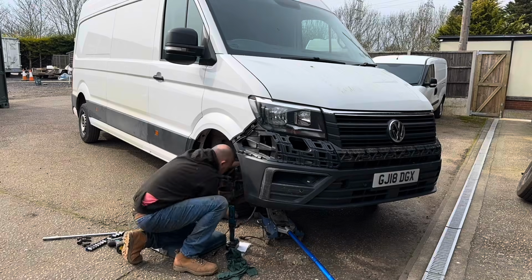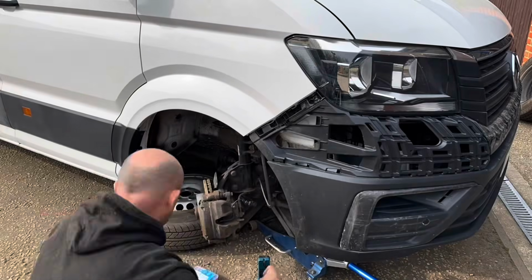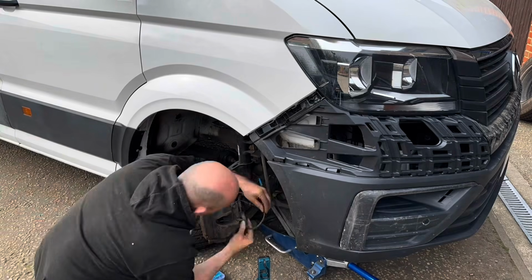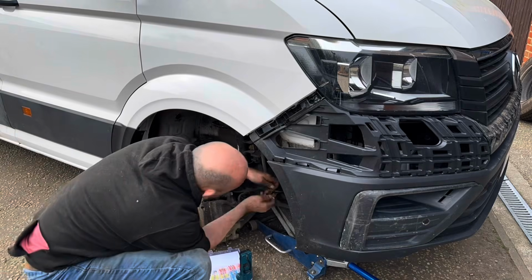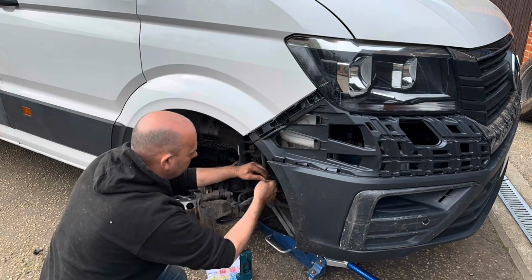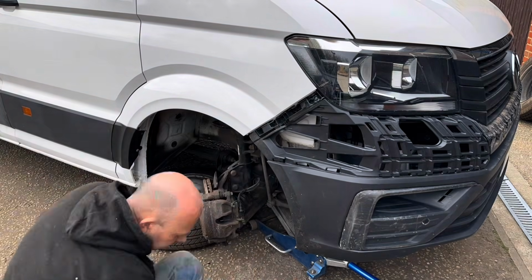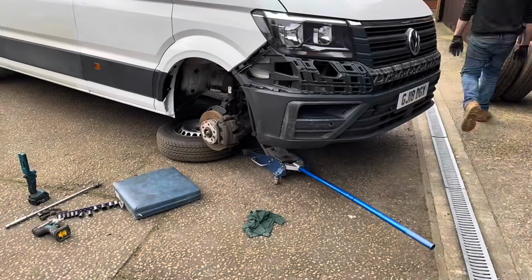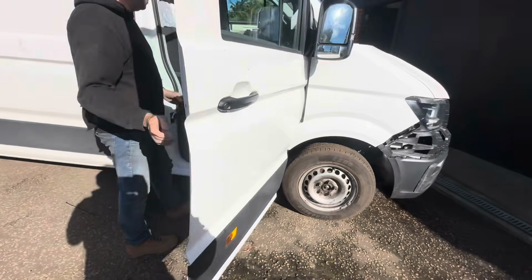I think this particular section I've just popped out, gone to get Chris a new brake pad wear sensor, and the plug that actually holds the brake pad wear sensor had previously been cut off, or ripped off actually, in the accident. Of course this wheel was completely missing when we got this van, wasn't it? So he's getting that on there, soldered on, and then fitting the brake pad wear sensor. Chris has done all of the wiring issues that were down there now and done everything else.